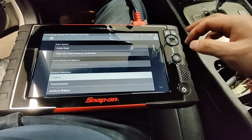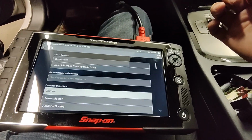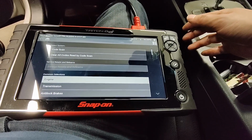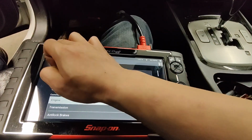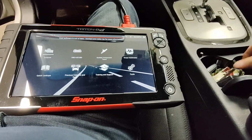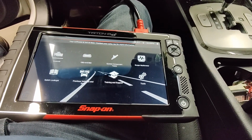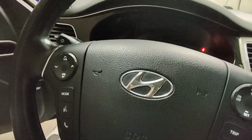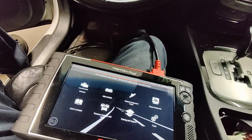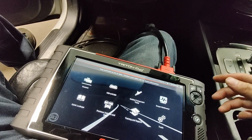And yeah, if you have a Hyundai, Accent, Elantra, Veloster, I guess the majority of Hyundais and Kias, when they come to a stop and then the engine stalls out, most likely it's a bad crank sensor, or it's not an engine that's about to lock up or something like that. But make sure you pay attention to the tachometer, because if you see 0 RPM and your engine's still running, that's definitely a bad crank sensor, because it uses the crank sensor to read RPM off the crank.